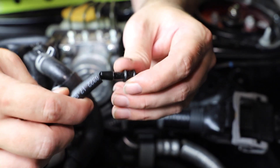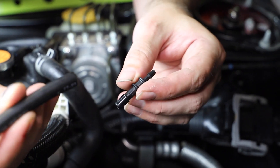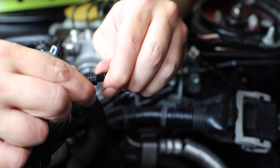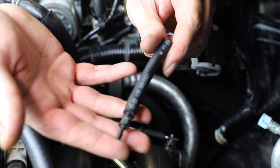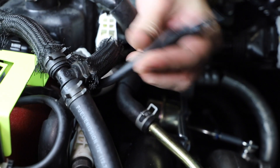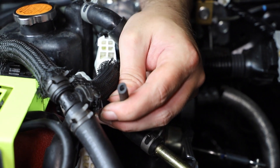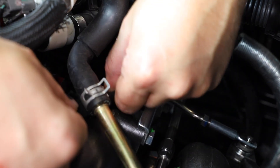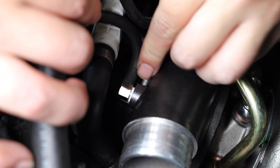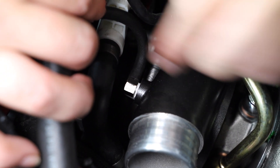Find the hose and fitting that are included in your kit to extend your BCS connections. Push the fitting into the hose. Find port 2 on your BCS — the line that goes to the actuator — and press in the extension, then run the line to the actuator. Now find the boost reference hose, port 3 on the BCS, and plug that into the nipple on the compressor. Zip tie all connections to ensure they don't come off.